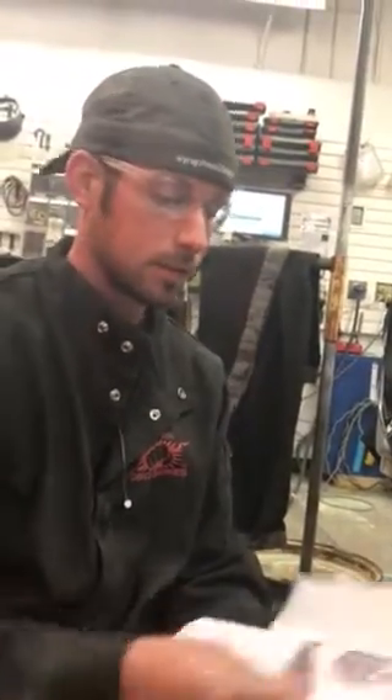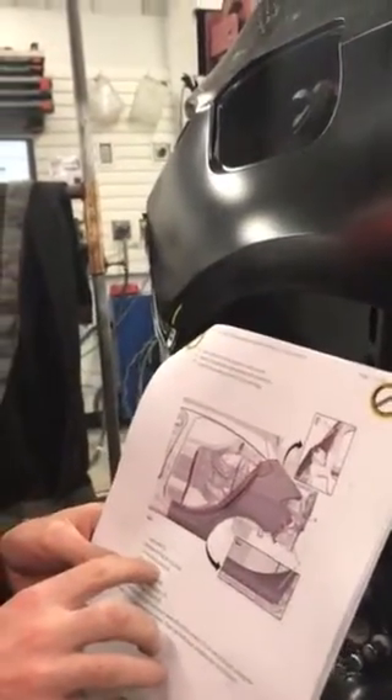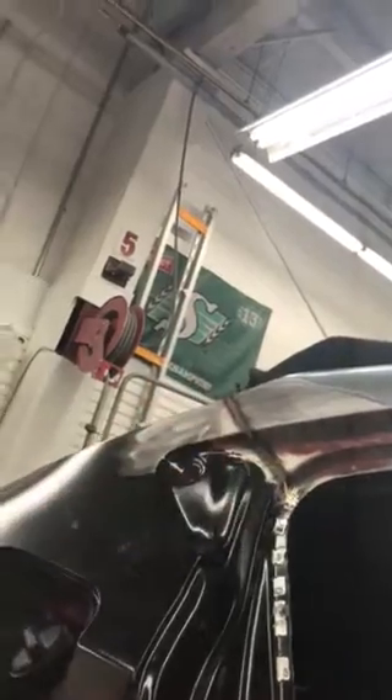You're still going through it and double-checking your sectioning areas. On this one, the braze joint up in the quarter panel section shows a 370 millimeter braze seam — that's number four down in this area. You're measuring to make sure you're in the right area. Up in the sail panel it's 260 millimeters, so you want to make sure you're sectioning in the exact spot they're showing.